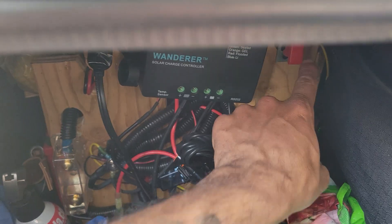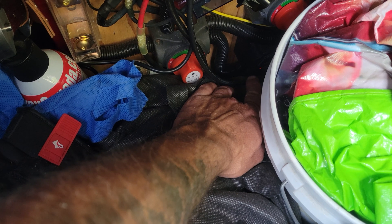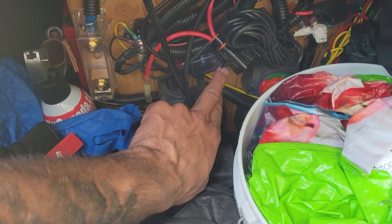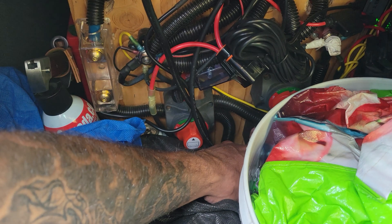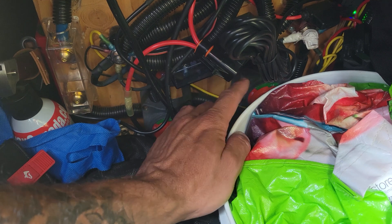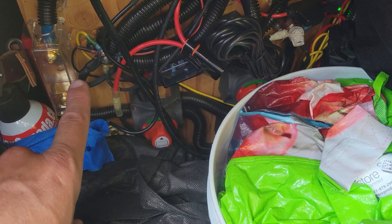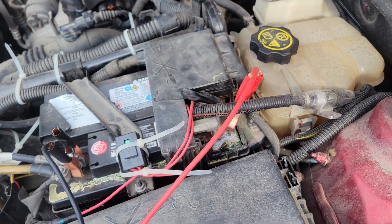That's the fuse for the front 12 volt plug. I've also got the fridge plugged in here and it's also fused. That's it for the load side. This is for the isolator — the dual sense isolator — and you can see the LED is on so the starter battery is being charged in the front. This is to disconnect the batteries completely from the system. This one disconnects it from the alternator, which disconnects the dual sense isolator solenoid from the system as well.